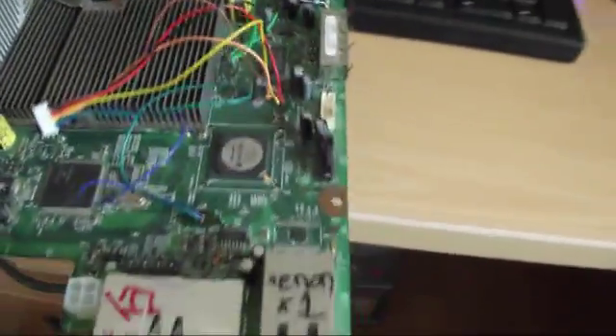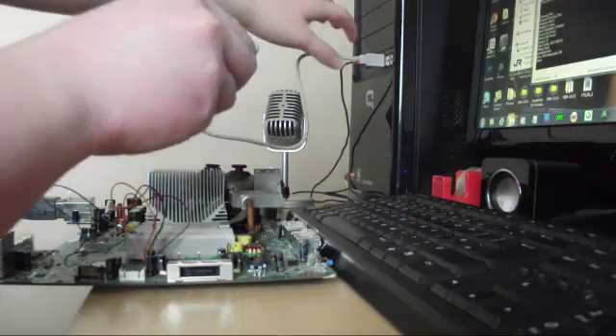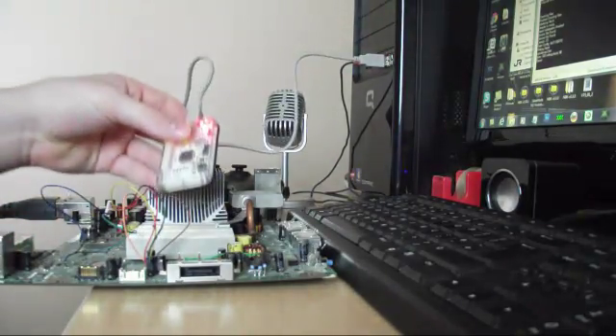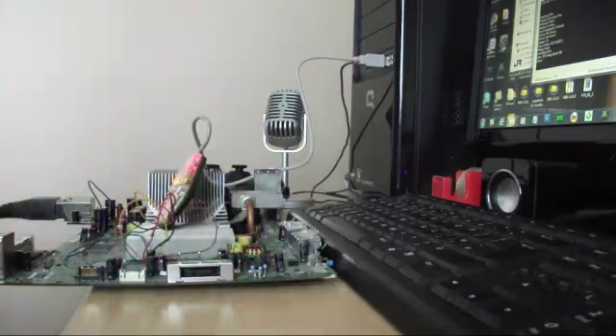Lift the console over to your computer. Now get your NANDx and plug it into the USB port. You have to install the drivers on your computer first, otherwise it won't work. Make sure you always plug into the same port on your computer, otherwise it won't find the device. Then plug your NAND cables into the NANDx and you're ready to go.